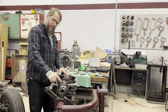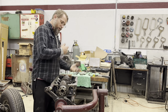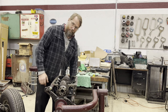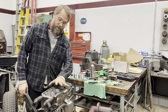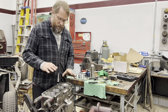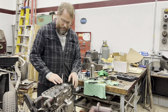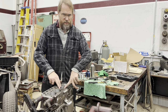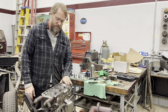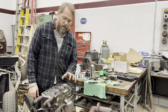I'll put pistons onto the ends of the rods and check every single one the same way I did with the main bearings, making sure what my clearances are. Then we'll take them out, clean everything up, and put them back in just to check deck height. Once again, everything is checking about two thousandths - consistent with what I'd normally be looking for. Note that these are not actually finished bores yet - they're just rough bored to the correct size and not finished honed yet, because we were still waiting on pistons. When I send this back, the pistons will go with it and he'll measure them all to make sure we're getting the correct bore clearances.